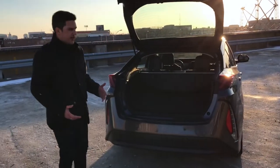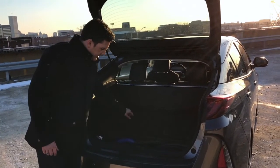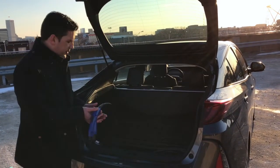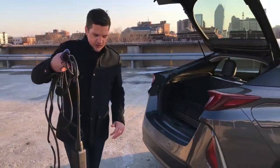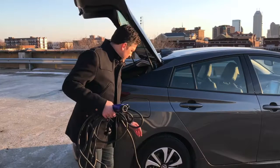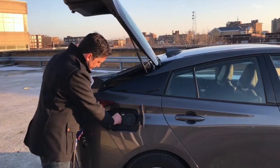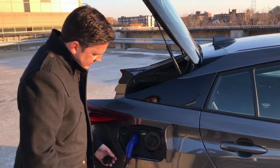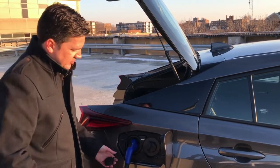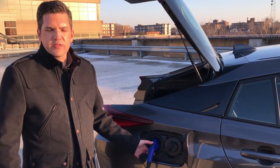Come inside. One of the really nice things about the Prius — you've got the hatchback, seats fold down, quite a bit of storage space back here. But when you lift up this little cover, this is where the plug's kept. I want to show you real quick what you have to do to plug the car in. Unfortunately, we don't have a charging station here. But where you think it's the gas cap is actually the plug — there's a gas cap on the other side of the car. You plug it in, it clicks into place. There's a light that turns green to tell you you're plugged in. To charge the vehicle takes about five and a half hours on household current, or about two and a half hours on a 240-volt charger.